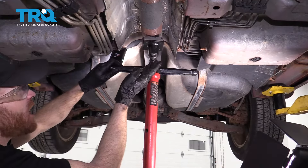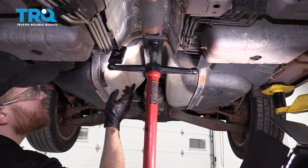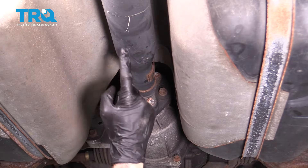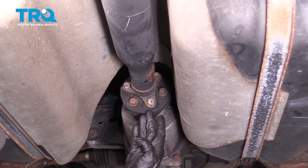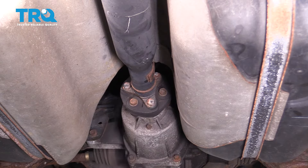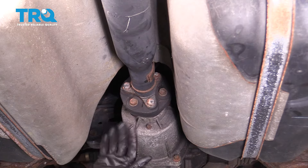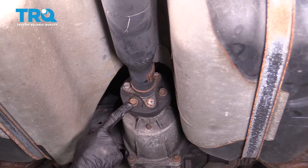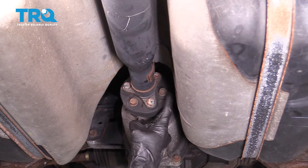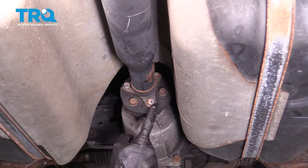Take the jack and go right underneath the driveshaft, adding support so we can start removing the driveshaft from the rear differential. With the exhaust out of the way, let's move along to the rear driveshaft. You'll find six 15-millimeter headed bolts holding this together — we're only worried about three of them right now. The bolts going into the rear pinion, which is part of the rear differential: one here, one up there, and one directly across — essentially a triangle. Leave the ones going to the rubber mount alone.